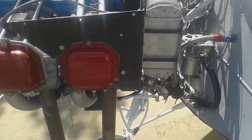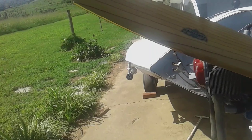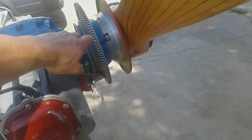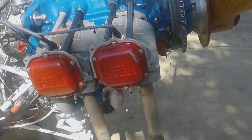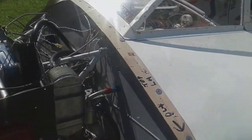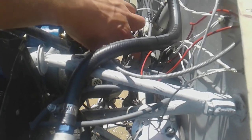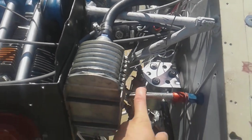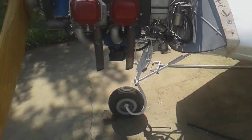Main fuel pump and pressure regulator, starter solenoid down there. This prop is a Sensenich prop that John Dyke designed for this airplane — it has a very large hub and adapter. It's fitted with automotive plugs and wires. Slick Magnetos retrofit pretty easy for that and they're double insulated. Fuel return line, since we're using car gas and the airplane is already plumbed for that — that'll keep any vapor lock issues away.